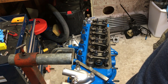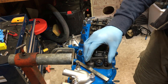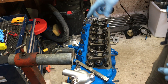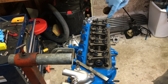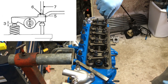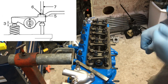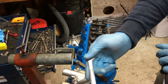Let's rotate this over and get a valve at compression. Right now valve number one is fully compressed. What that means is we need to be adjusting valve number eight, which is this last one right over here. As you can see, that's really loose right now. Get your flathead screwdriver, which goes inside these little flathead openings. This is a locking nut, so you'll tighten your flathead bolt down with your socket wrench. Once you have reached the adjustment that you want, then you tighten that down while making sure the screwdriver doesn't rotate. You'll need a flathead screwdriver and a seven-sixteenths spanner.